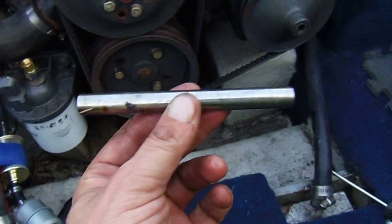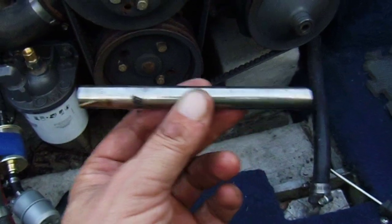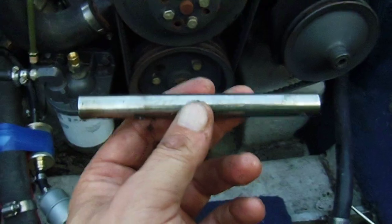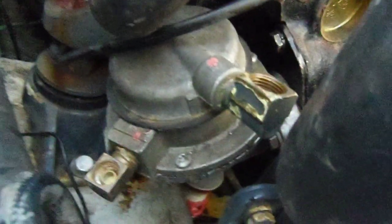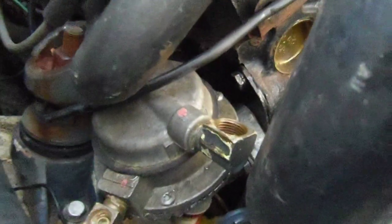What you've got to do is take off your fuel pump - take the lines off, take the fuel pump off. There's a little plate, take that plate out, then you'll see there's a little bolt holding an additional plate. Take that plate out, then you've got to pull out this push rod that makes the pump go. You don't need that. The pump is now just being used as a plug. Get this pin out, put it all back - you don't have to get new gaskets, you can use silicone to close it back up.